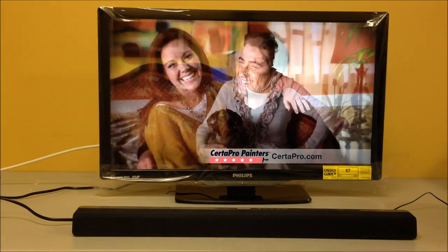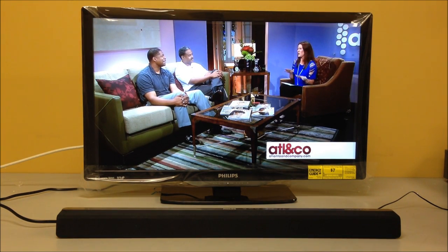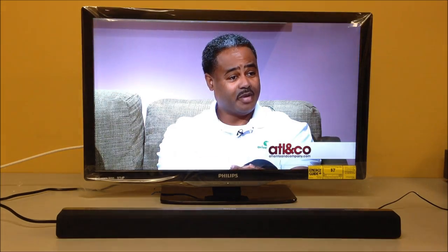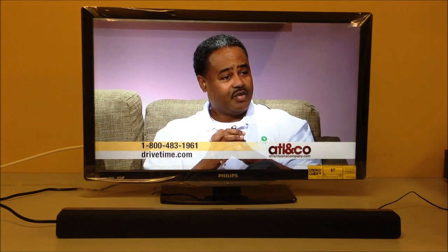This particular sound bar unfortunately does not support Dolby Digital. Most audio sources — such as TVs, Blu-ray players, cable boxes, and satellite boxes — have settings to change from Dolby Digital to PCM. Directions are available online at philips.com/support and in the user manual. If you use analog audio, it will always work since Dolby Digital doesn't transfer through analog.